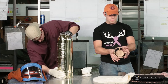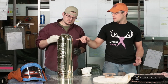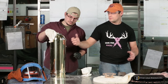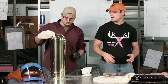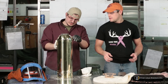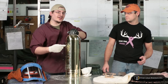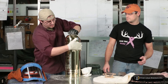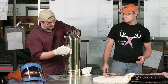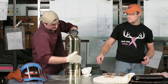Nicely blasted. This is a beautiful copper lid, and the remaining body of this is all brass, with a security tab to hang up on the wall that was just plated steel. You can see the way I'm actually wiping it down — I'm not going against the buff pattern because we don't want to create any more scratches just in case there might be a grain or two of dirt or sand or whatever. We're going to go with the buff so it keeps that nice even polish.